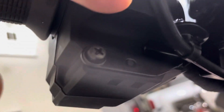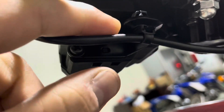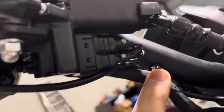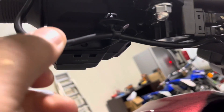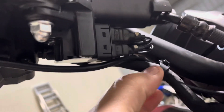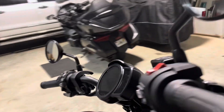Back that screw out and attach the bracket — there's a little index waiting for it. They're going to give you your first zip tie; mine was already installed. It tells you to put a mark at 10 millimeters, then another one, then another one further down. This zip tie pushes up into the bracket. Then it comes down and here's your first replacement zip tie — it mounts on a little welded tick on the bar. Use a small flat head to lift the index that keeps the zip tie on that welded tick, pull it off, re-zip tie it, and slide it back on.